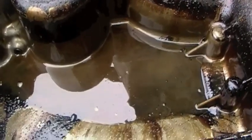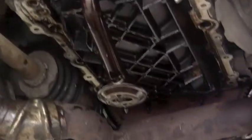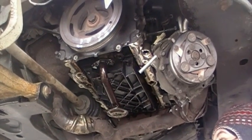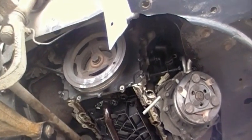We've got the oil pan off now, and you can see all the creamy colored stuff in there - all the antifreeze that was in there - and you can see all the sludge is starting to build up. That's not good for the oil pump, and that's why a lot of people see the oil light on when they're driving. You can also see the pickup tube, which has got a little bit of antifreeze stuck in it. It's not too bad, but it's at the point where I would probably want to just change the oil pump while I'm down this far.